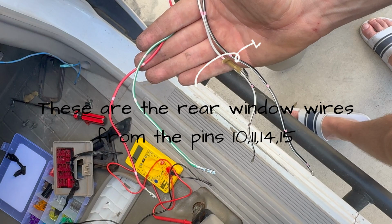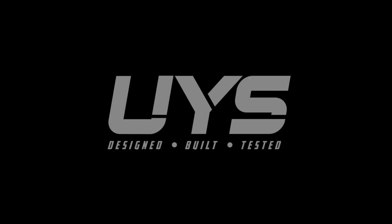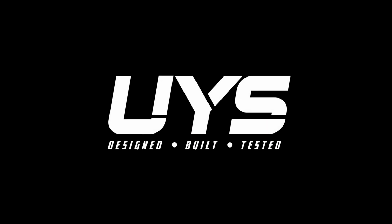So basically that will take the two top switches on your control module out of play, so your driver and passenger window switches will not be in use. You'll be able to use the two bottom switches, which would have been your rear left and rear right switch. They will now be your main two switches, so you'll be able to open and close your driver side and passenger side windows successfully.